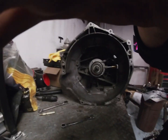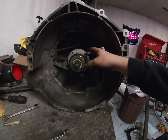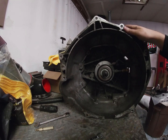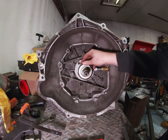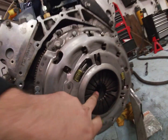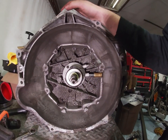I'm probably going to want to install the line before I actually get the slave cylinder on. Now I'm going to check the clearance from the throwout bearing to the bell housing. One thing you want to do when you put a new slave, clutch, and throwout bearing on is measure the distance of the face of the throwout bearing to the fingers in that clutch. How you do that is you measure these fingers to the block and you measure the face of the throwout bearing to the bell housing, then you do the math.